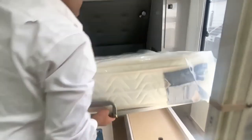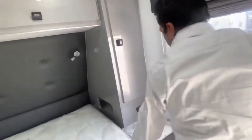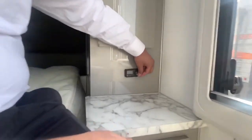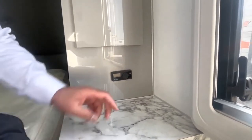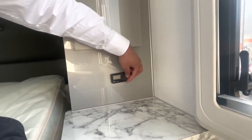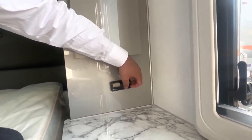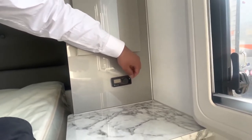On this one you've got the diesel heater controller here. It says long press for two seconds - take the plastic film off to turn it on. You can set the temperature to whatever you like by pushing the circle dial. For example, 36 degrees Celsius. Set how many minutes you want - say 10 minutes - then push it on and you can see the red light comes on.